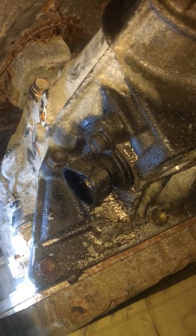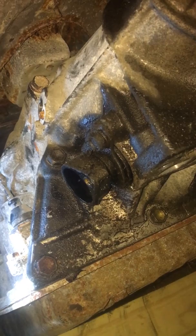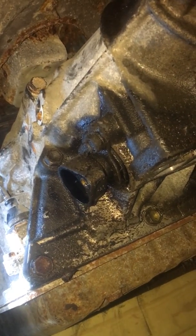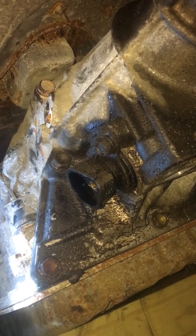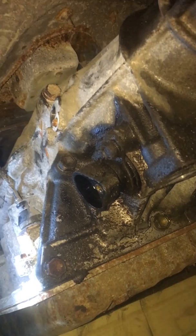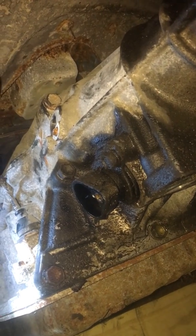I did lie — there's an extra bolt hiding right down there in the middle. These are 14 millimeter. Do not use anything else, even if it looks like it may fit — do not use an SAE, use a 14. I broke one at the junkyard and had to chop off a chunk of the transmission to get that adapter out. Use a shallow socket; a deep socket is just going to screw up the bolt.